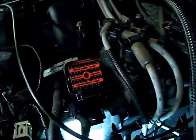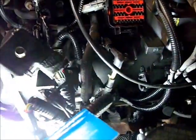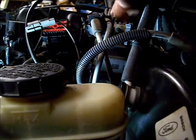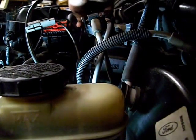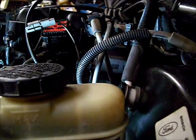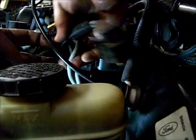I took this 10mm loose on the main engine harness so it's free and clear. I took these 5/16ths bolts out of the top of the intake plenum to pull the bracket mount. Then I dropped the plug wires out of the way.